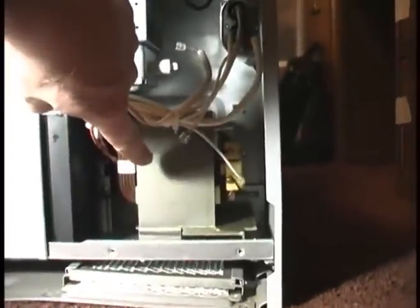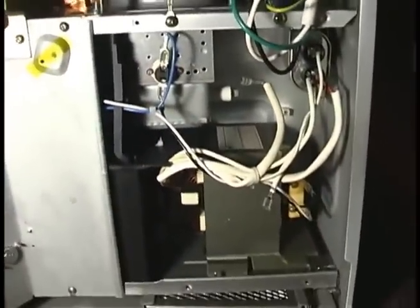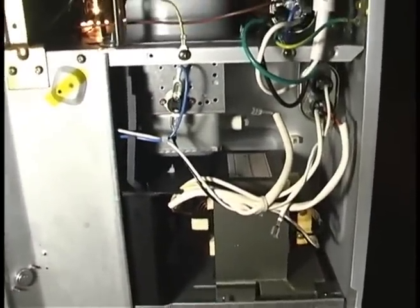I've put a light over here so we can see in here a little bit better. This is the high voltage transformer — this is what powers the magnetron tube. This magnetron tube is what sends the microwave's energy down the top into the microwave. These are the two components that usually go out.